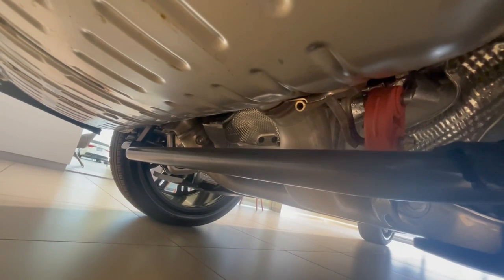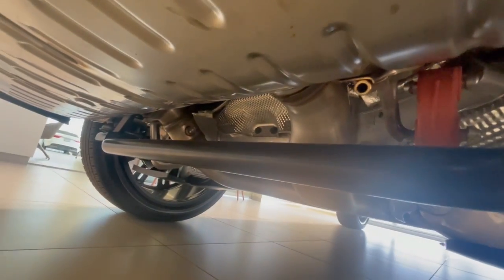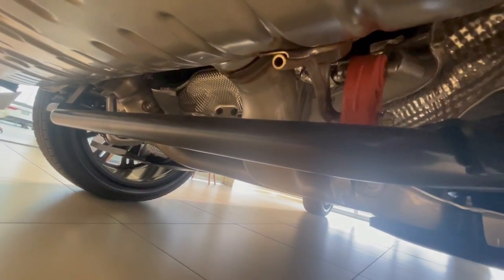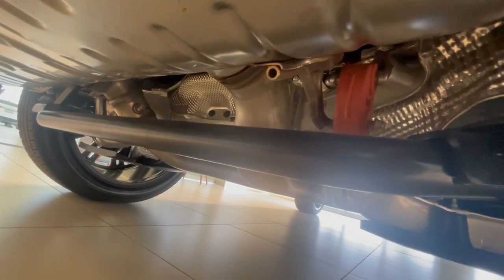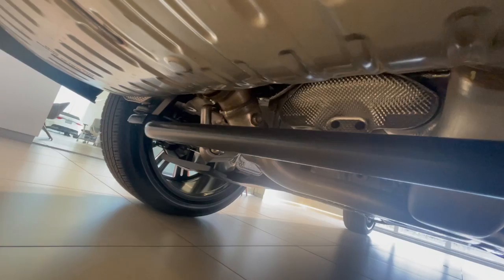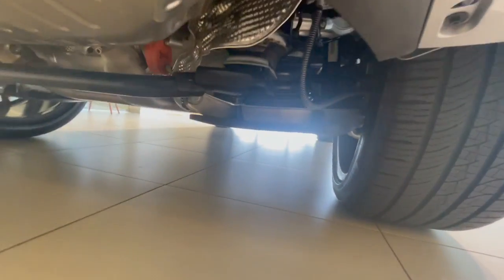This is the roll technology — it's called Dynamic Roll Response Pro. It's currently standard on all Range Rovers but will become optional on the SE going forward. They have a 48-volt electrical system with super capacitors that can deliver up to 660 and all the way up to 1,032 foot-pounds of torque to help the car not roll. This is actually tied into the navigation system — when you're coming around a corner, the car already knows it and within 200 milliseconds can deliver that torque to keep the car from leaning or rocking side to side. You can see the exhaust as well: two pipes come through, split into a muffler, and then you have quad exhaust, two on each side.